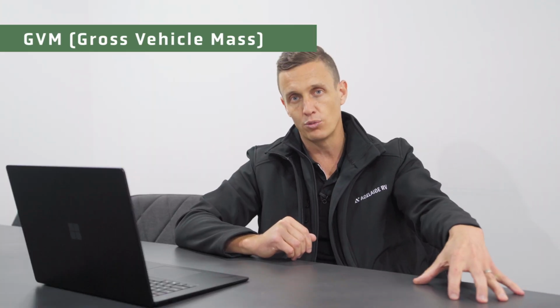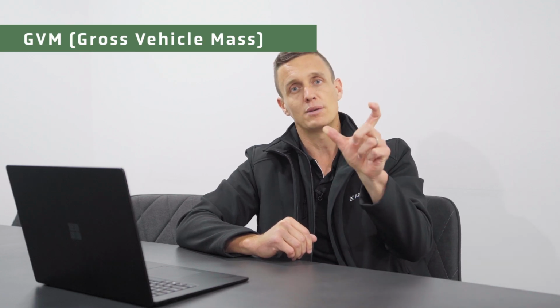So it is really important that you establish: what's the curb weight of my car? What's the GVM of my car? And what's the difference in between? Have I got, call it, 1,000 kilos carrying capacity in the vehicle? And now what do I weigh? What does the wife weigh? What does Stella weigh in my example? What are the kids? Do I have a bull bar? Have I put a second battery in? All of these items add weight. So that is on the vehicle side of things.